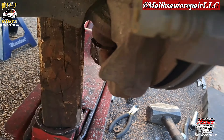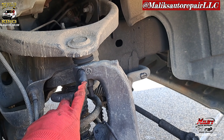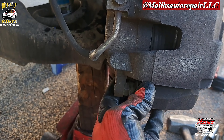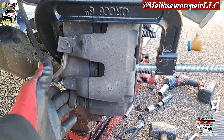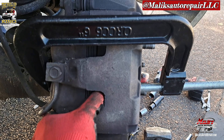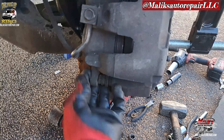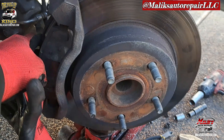To get that bottom out I put a little pressure on it with a little block there, but looks like we're gonna need to take out this upper control arm, knock that out, and let the spindle hang, then knock the spindle out. So we're going to go ahead and take off the brake caliper — and this is what I found out: they don't even have a bolt at the bottom. Get your C-clamp out and compress those double pistons. If you don't, you won't be able to get it off just by swinging it. The caliper has little notches on the pads that hold it from sliding off — that's why it hasn't flung off. Hang that up so it doesn't fall and break your brake line, then take off your pads.